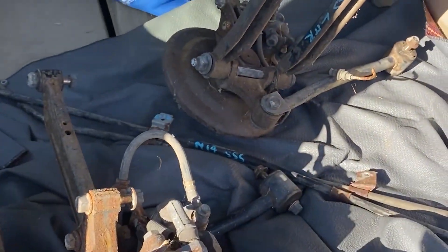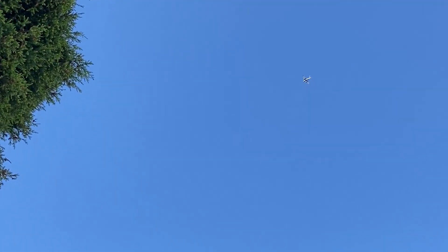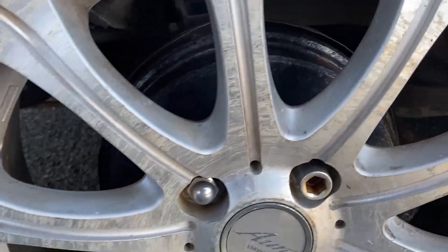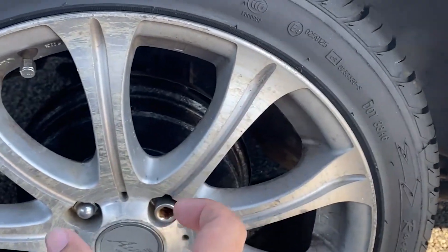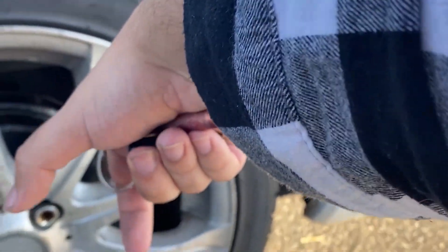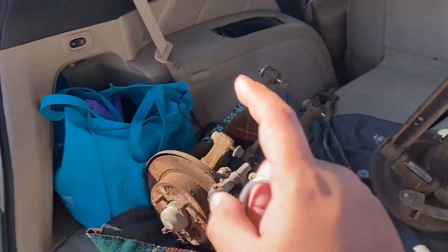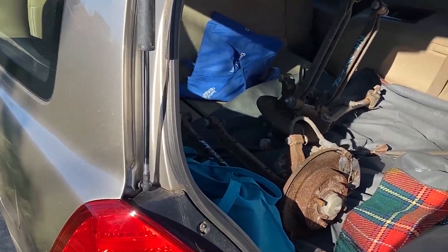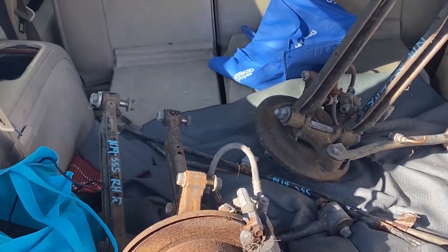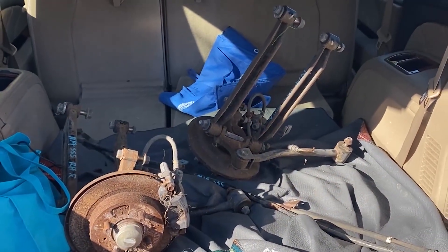As you can see here, these are brake rotors and a rear brake setup which came off an N14 Pulsar Triple S. If you look on the Nissan Exa, right in the rear here, we have drum brakes. Instead of having a caliper that squeezes the brakes from the outside, you've got a drum with two shoes that push in and out like a handbrake would. I have to replace that with these disc rotors, which will give me better braking on the rear. Triple S brakes are a lot bigger and can probably handle a fair bit more power. Anyway, that's the new upgrade for this week.